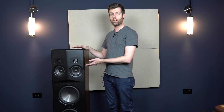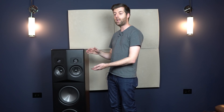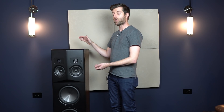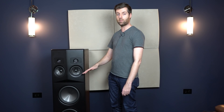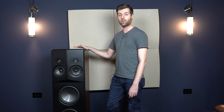In addition to the parts you can see — the Stereo Dimensional Array, the tweeter, the midrange, the woofers — there are components that make this a top-of-the-line speaker that you can't see. The crossover is of their own design, named after the designer, and it is a very large high-quality crossover. It's a three-way speaker, so the woofers are crossed over at the same frequency to the midrange and tweeter. I saw pictures of it and it had a very large component count, so it definitely appears to be a very high quality crossover.